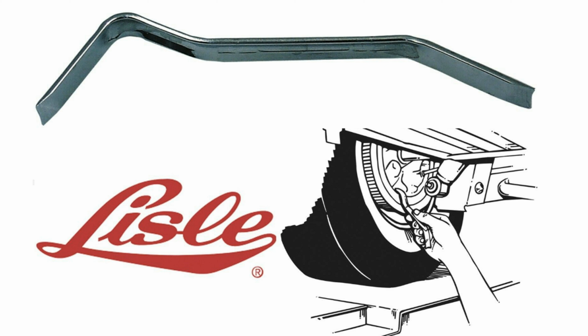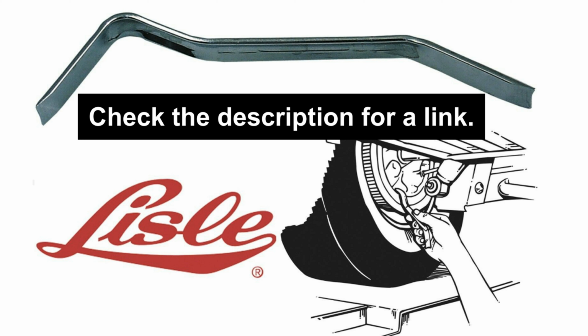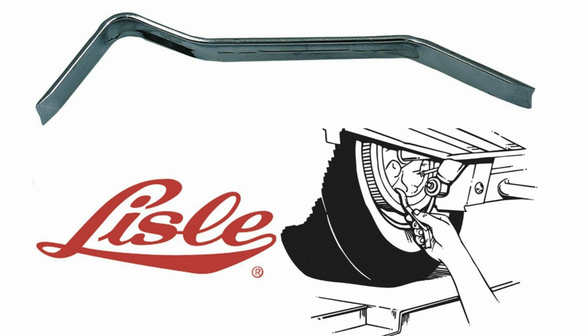Depending on the particular vehicle you're working on, you can use either a screwdriver to lever the star adjuster around, or you can use one of the many specialty tools that are available to do this. You can see in this diagram how it looks when a mechanic uses it through the backside of the backing plate.